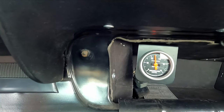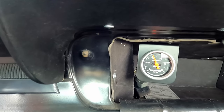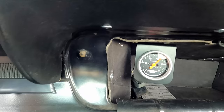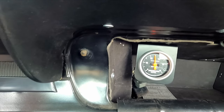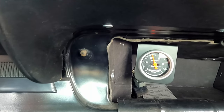Running just over 13 air fuel ratio at cruise — that's a little rich. This is where I need to learn more about where I need to be for cruise versus power and all that. That's some of the stuff I'm going to learn going forward.